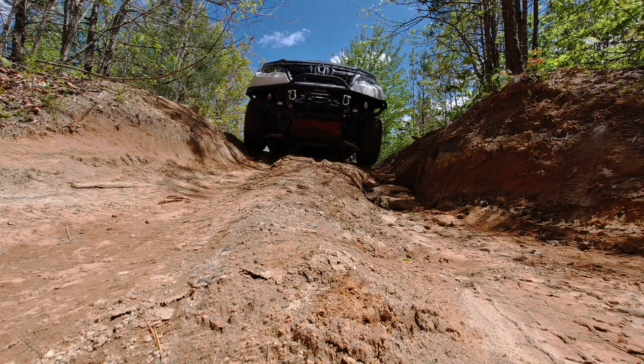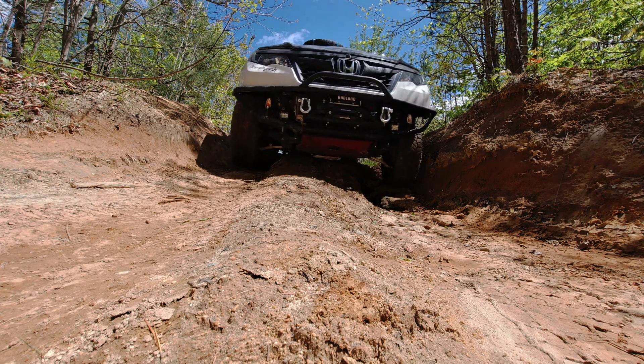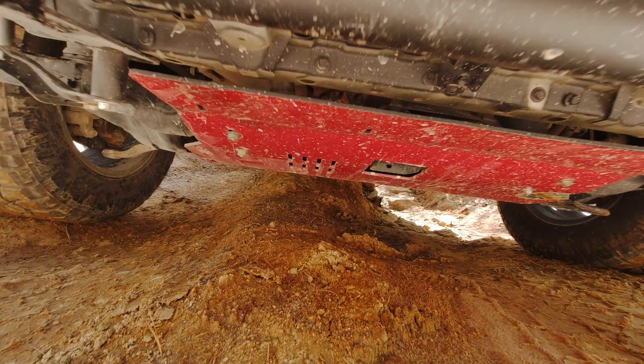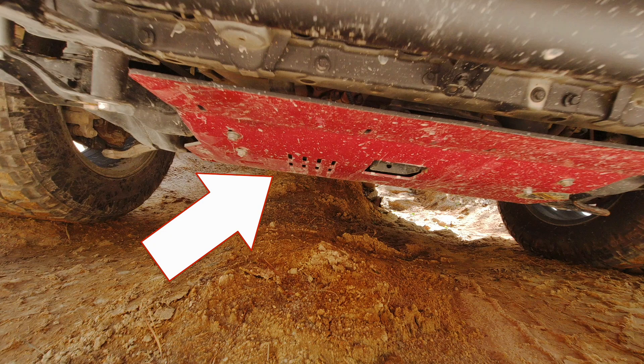The basic beginner intro to going off-road with your Honda - number one is a front skid plate. If you've looked underneath your Honda, that oil pan is exposed. I had a buddy that we went off-roading with who did not have a front skid plate, dropped down on a rock, punctured his oil pan, and they had to JB weld it. He had a five-hour drive home and it held, but he did have to replace his oil pan.